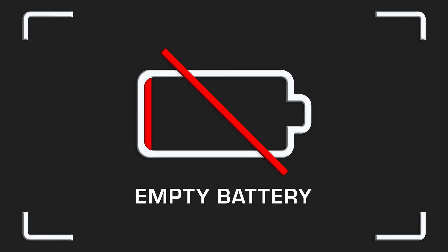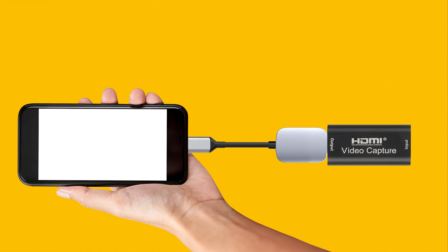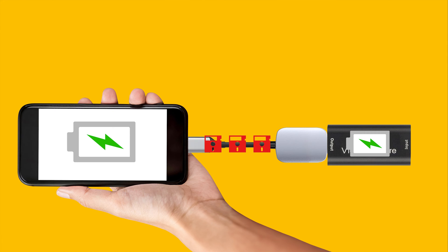But the drawback of this setup is that you can only use your phone for as long as it's got battery power. The obvious solution is to simultaneously provide charge to the phone while the phone powers your video capture accessory. Most modern phones can be used in USB host mode. That enables connecting and using a USB peripheral device where the phone provides power to itself and the accessory, plus communicates with the peripheral device by using an on-the-go or OTG connection.